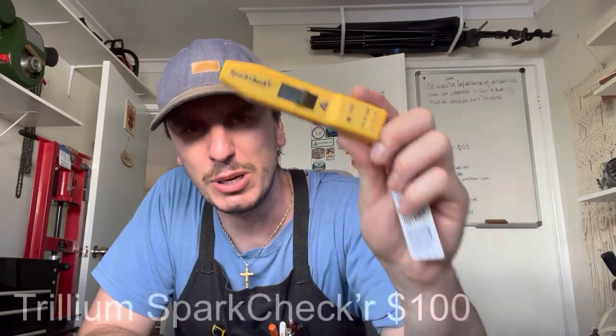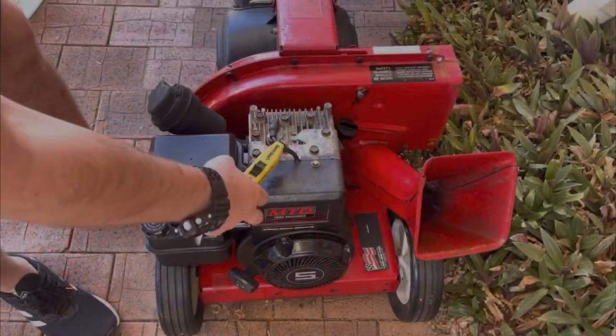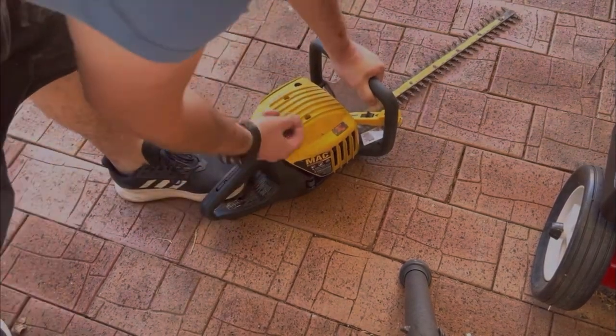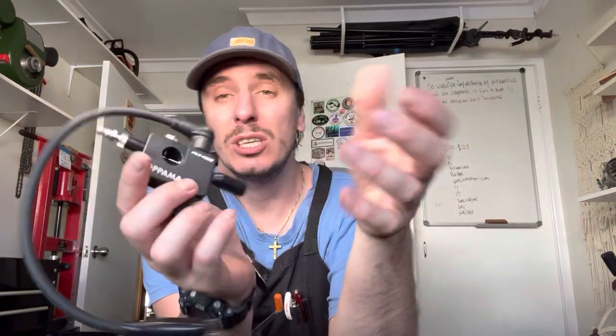The next one: a spark tester. I have spent too much money on spark testers in the past. I actually recommend this one — I've used it about 30 times over the past few weeks. What I love so much about it is you can clip it on and forget about it, pull your engine over, and it will flash and stay flashing to tell you whether you've got low, okay, or high spark. I've got voltage values for each of those lights. The reason this is so nice is you clip it onto the engine, pull it over, go back round to the front, and you can see exactly what you've got. The reason I don't like the ones that load the coil and have to jump a gap is you just can't see it most of the time. It's a nightmare.